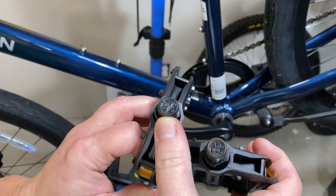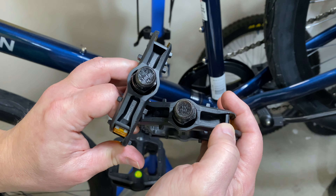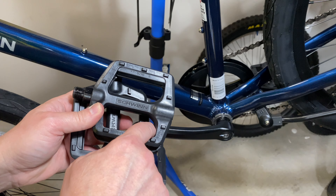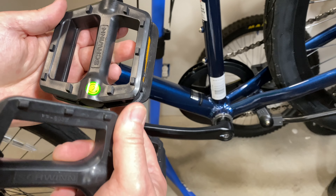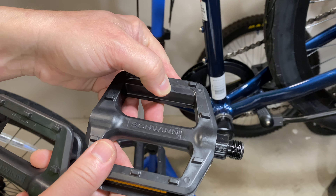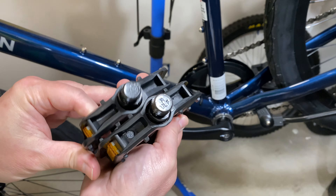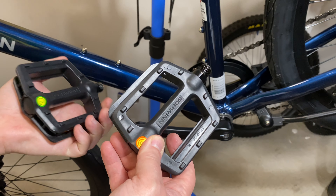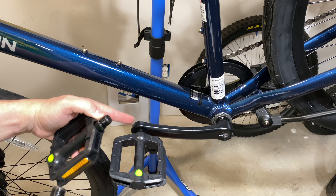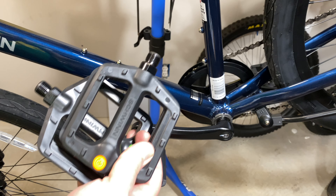Now to the left-hand side — sitting on the bike, left grip, left leg. This is the one most people mess up because it goes backwards: tightening is counter-clockwise. That really messes with the human mind. Take your time, just like the other side — down and back, down and back, that's the direction you want this turning. Start it gingerly and feel around until you get it started. If you feel any resistance, back it out clockwise and check the threads.